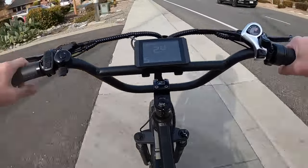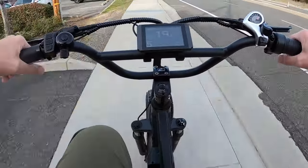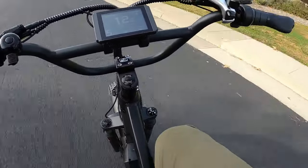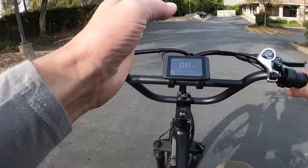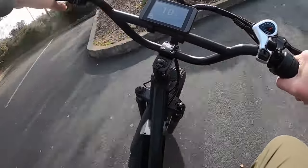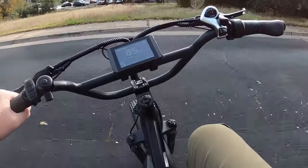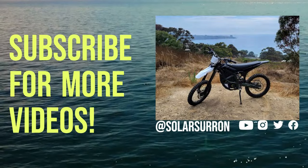One last thing I've also noticed: in my previous videos my rear brake was having a little squeal — there's no longer any squeal in the rear brake. I think the pads finally just fully bedded in. The bedding-in process is where the brakes leave a little bit of film material on the outer coating of the brake pad to get seated on the rotor, creating a perfectly flat, smooth surface from the rotor to the brake pad. I've noticed now just a little bit of a squeak, but not nearly as bad as before, and I think that's going to be completely gone shortly. I promise that's the final update for this video. Stay tuned for the next one — I appreciate it. See you next time, be cool.